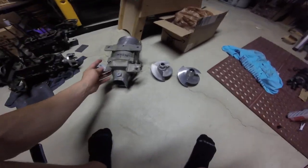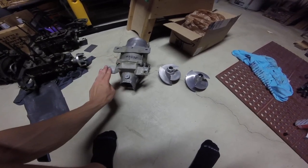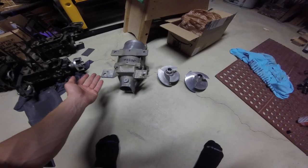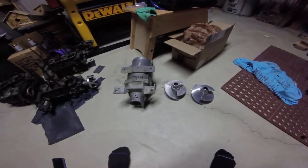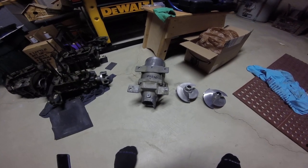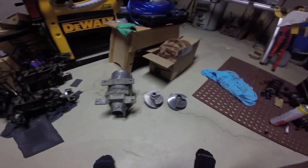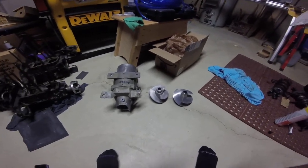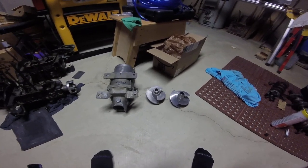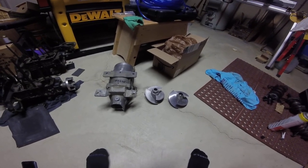With the 550 pumps, it really doesn't happen, because I have basically my engine maxed out, modified. I mean, I could run a timing advance, a couple tiny modifications, but it's basically maxed out, and I have a 15 impeller on it, and the thing hauls. So no cavitation issues, nothing like that. So that's really the lowest pitch you want to go.